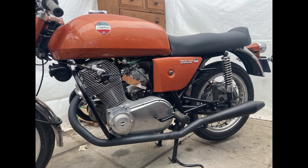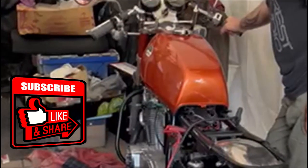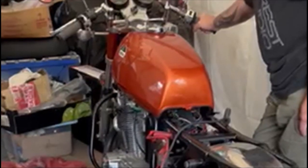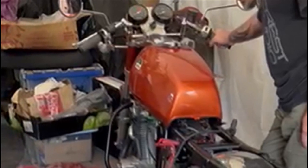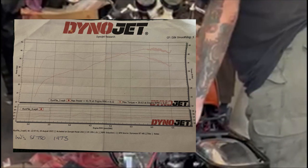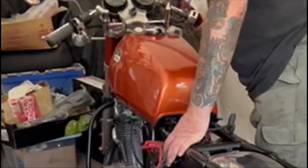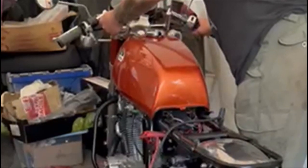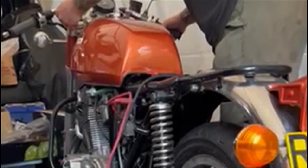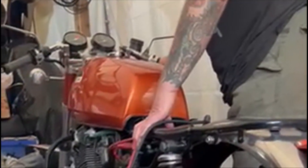The carbs had been bench set, but as always that's only half the job. You can hear it running here. As the bike is ridden more, it is improving with each ride. The dyno at SPR Racing gave me the last bits of information I needed, and I will get rid of that small flat spot in time. It hit 44 horsepower and 40 newton metres of torque, and more importantly the mixture was fairly right all the way through, being a little rich around 4,200 RPM — that will be sorted before long. It hit just over 110 miles an hour, which is almost certainly faster than I'll be riding it most of the time. As things progress, I will try and film some more footage. You can hear from these short clips it has a thunderous sound and will raise more than a few eyebrows, I'm sure.